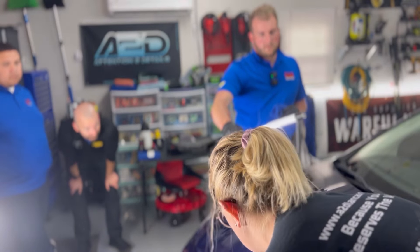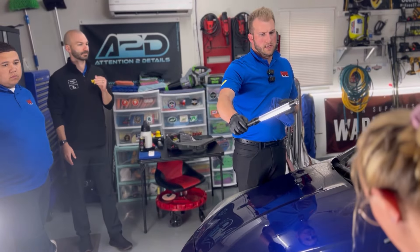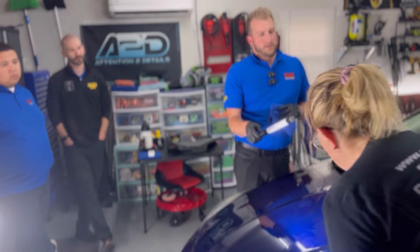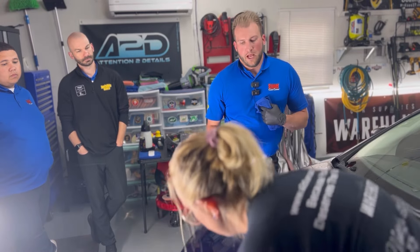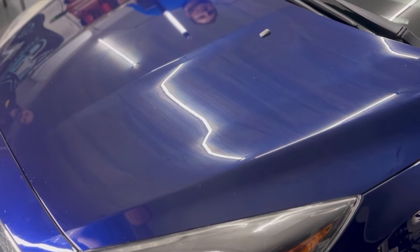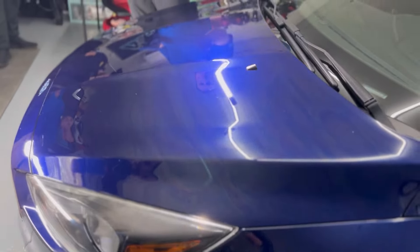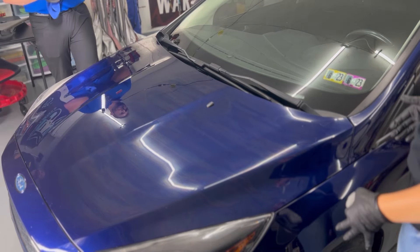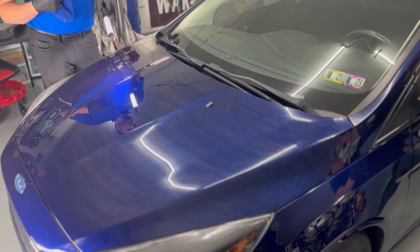I went heavier just to see how far we can go — not because the first section was wrong, but because this product is more forgiving, so let's take advantage of that. As a professional detailer I frequently apply ceramic coatings, and this is one of my favorite styles. When you see that rainbowing, that removes all the guesswork — the rainbow is your telltale sign the ceramic is bonding and the carrier is starting to flash off. Let's see how far we can push the timing; you could coat another panel, let it set up, come back and level, then move on.